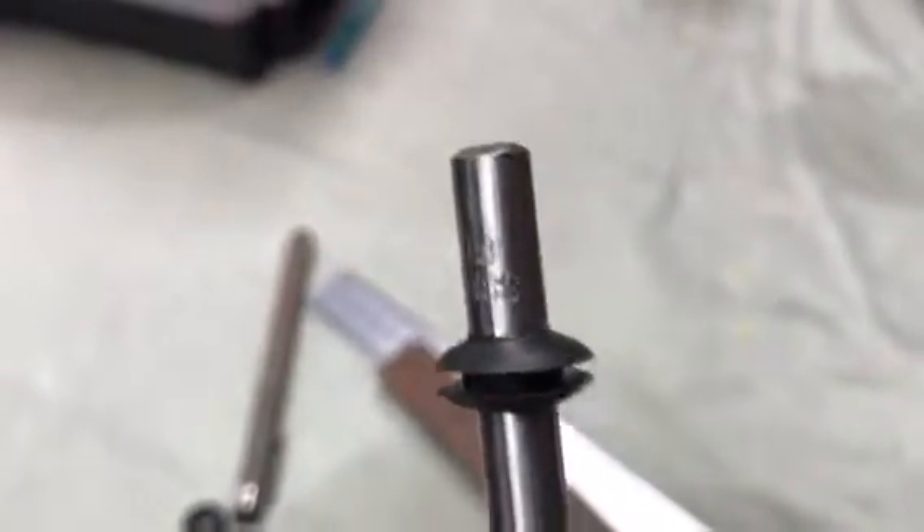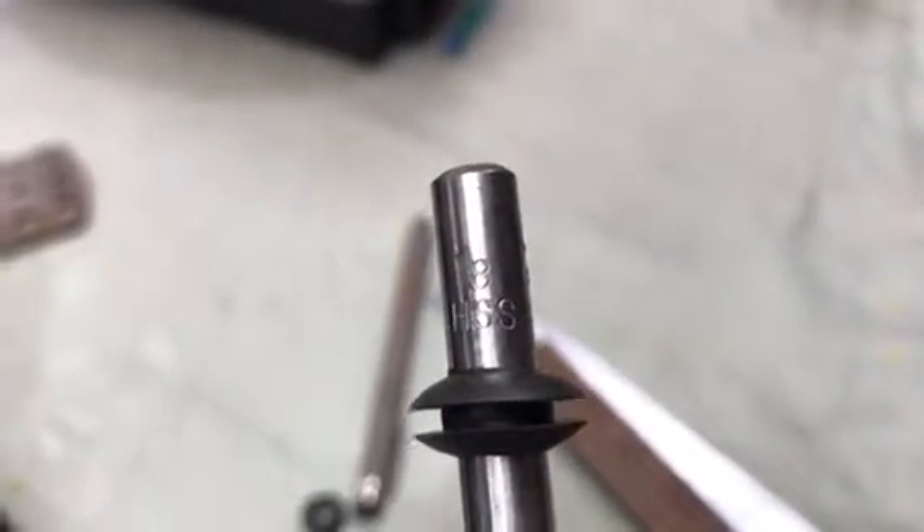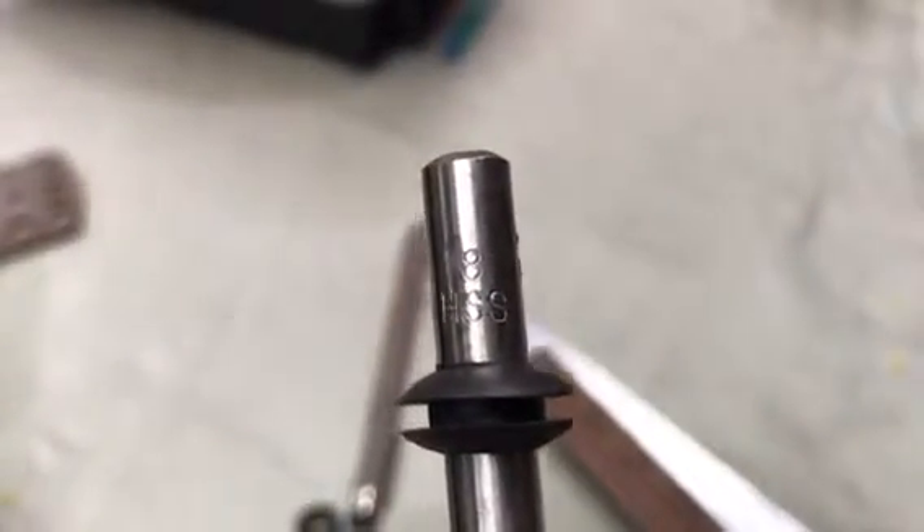Get a piece of masking tape loosely layered on there — that's going to show you where to drill the hole for the bracket. These clips have very sharp points on them, so they'll leave a mark exactly where we need to drill. Press it in, leave the mark, then drill those out and fit the grommets. I'm using an 8mm grommet with an 8mm drill bit — as long as the drill fits inside the grommet it'll squash the rubber and fit where it's got to go. Drill the 8mm holes through it.